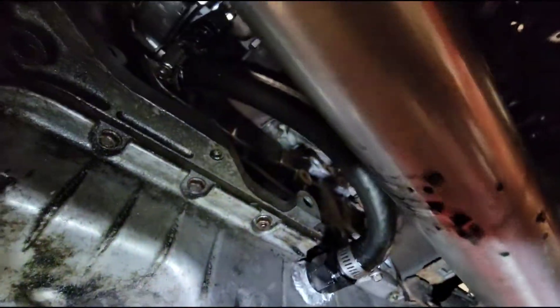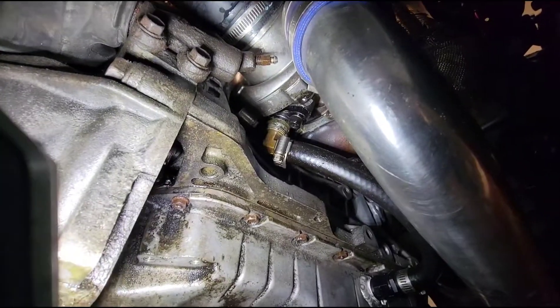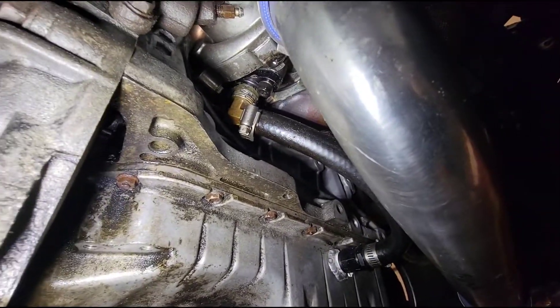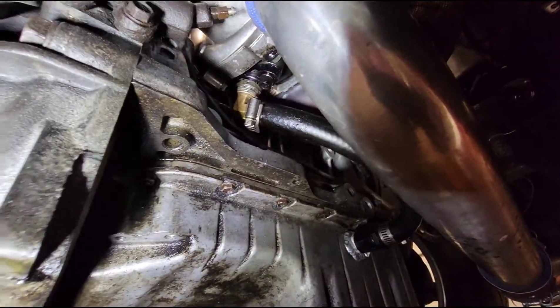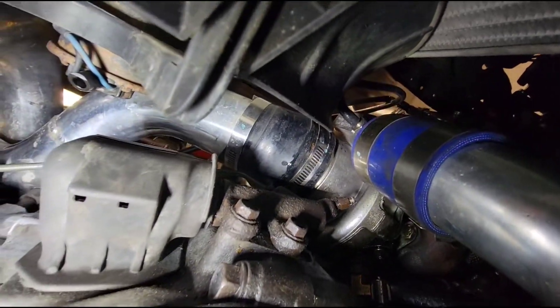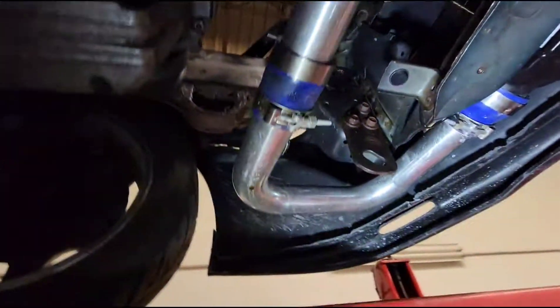The rule of thumb about the oil return line and the 90-degree fitting — it's kind of common sense, but if you don't know, you don't know. The oil is not going to want to flow because it's hitting that wall as soon as it comes out of the turbo. It's just not going to help flow at all. You can also see more coolant underneath on the intake.